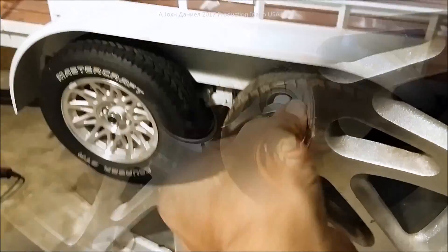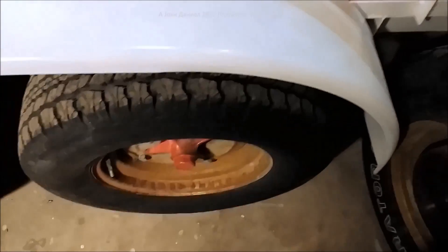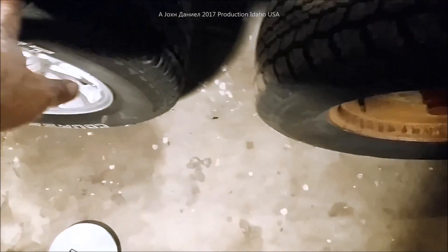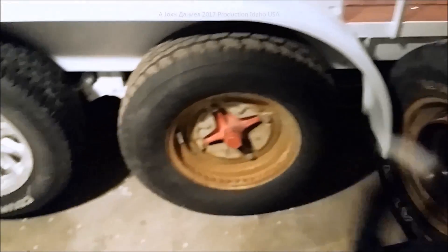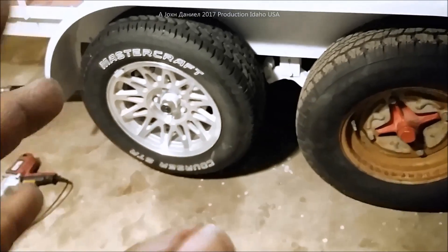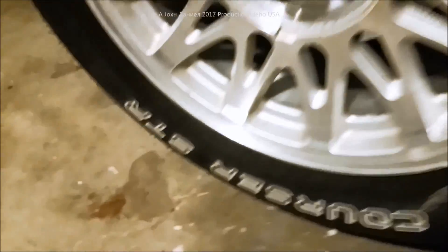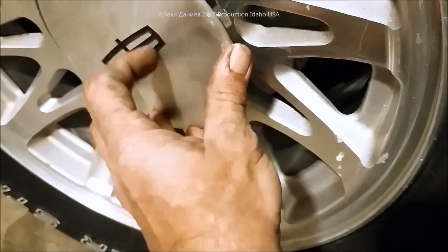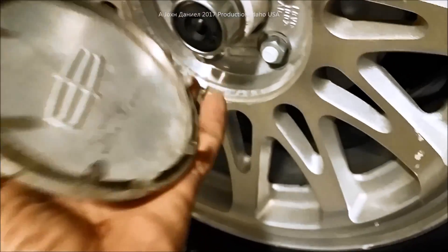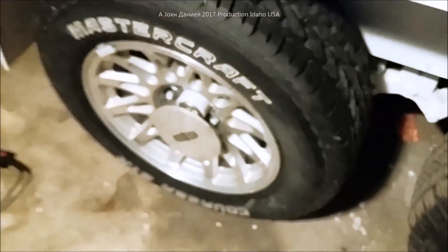It doesn't move at all. Both of these have the same amount of outer fender clearance. They're both the same style tire — this is a 16-inch, this is a 15-inch. This one here has a lot more sidewall flex. This one here is a Mastercraft, I believe made by Michelin. The grease cap does protrude past the wheel cover — I fully expected that — so what we're going to do is drill a hole through the Lincoln emblem and pop this back on, and it'll be a trailer with nice caps on it too.